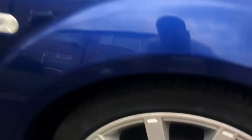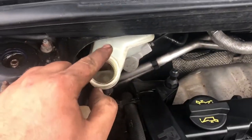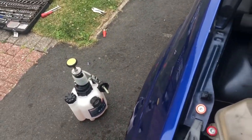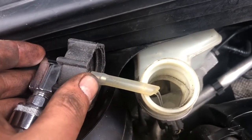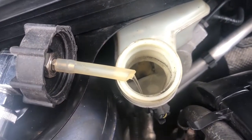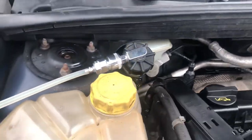All the brakes have had a tidy up for now. So we're going to be moving on to bleeding them — might as well do the clutch as well at some point today. First, you don't want to be pushing old fluid through, so we've just siphoned that out. Now we can refill it and put our pressure bleeder on. It is quite dirty in there but I've tried my best to get most of it out. So we're just going to keep pumping until it starts coming right up and then I'll screw the cap on. Got our master cylinder full.